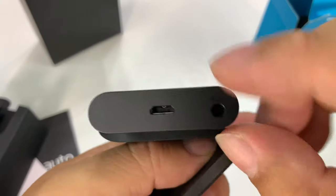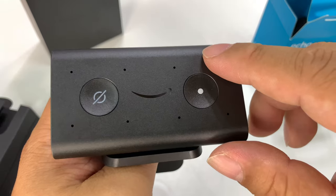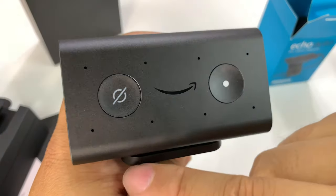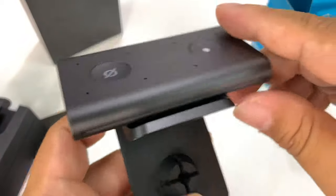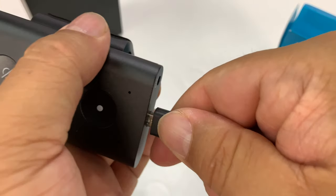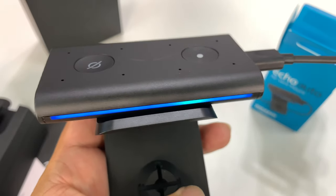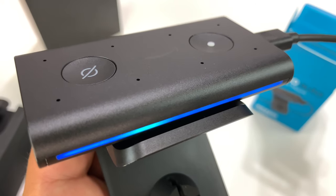I'm assuming all these holes are microphones to help pick up any sound. Not sure what this big slot on there is. Micro USB there, and your aux out. I think you will want to pair it to your Bluetooth in your car — hands-free protocol, A2DP. In mine, when you pair it, it connects both protocols. You have the microphone control button right there so you can turn off the mic. And then I think this is your mode button. But unlike some of the other Echos, you don't have the full range of controls — no volume and all that. It'll probably just output at the loudest setting and you'll control it on your actual car stereo. You're also going to have to pair it to your phone and set it up in your Amazon Alexa app just like any other new device.